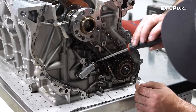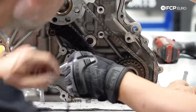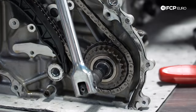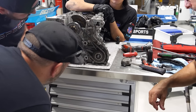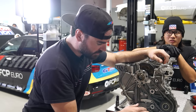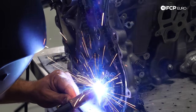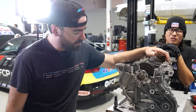Before the crankshaft can come out, we need to remove this intermediate timing chain. We're trying to crush this tensioner down, hold it in place, and get a locking pin in here so we can get this tensioner out without it flying apart. We just tried a lot of different methods for removing a very stuck bolt — including force, heat, curse words, and multiple technicians — all to no avail. Unfortunately, the idler bolt here, which is about an M10 thread, has been Loctited into the block directly. There's no access from behind, and the head twisted off despite our best attempts. So right now we're going to have Michael weld a little nut on top of that bolt and try to break it loose with a standard socket in hopes we can get that bolt out.